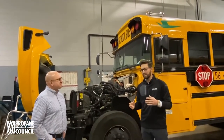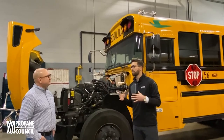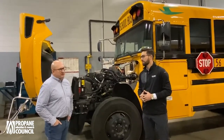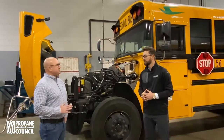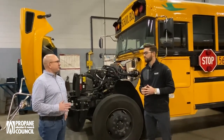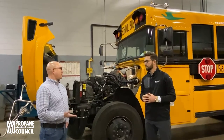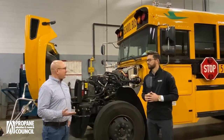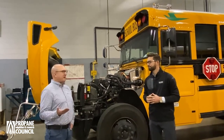As far as the initial days — even five years ago with all the different fuels out there — what stood out about propane and why did Derry Township choose it? After researching all the alternative fuel options, propane stood out because number one, there were no modifications we had to make to our maintenance facility — no changes to lighting, electrical, nothing like that. We don't have maintenance pits so we didn't even have that concern. No sensors or warning devices were needed to operate propane in our shop. Virtually everything is the same whether we're working on gasoline, diesel, or propane — same qualifications, same requirements.